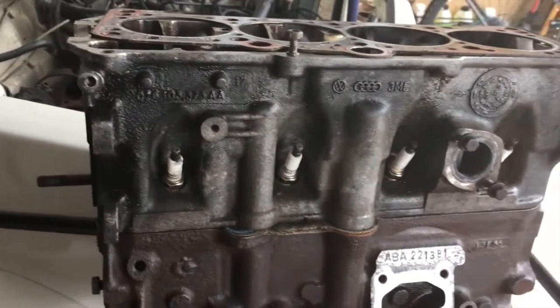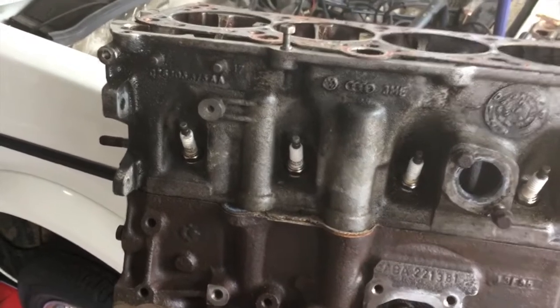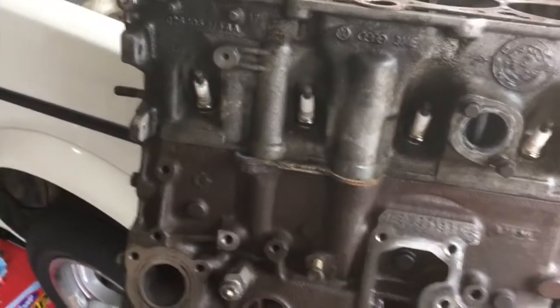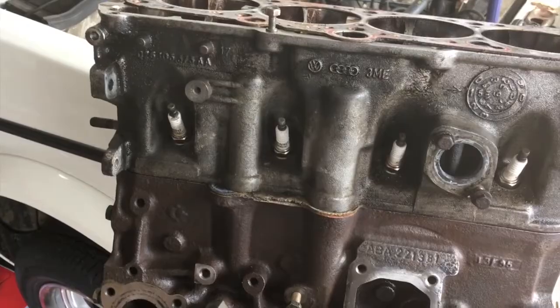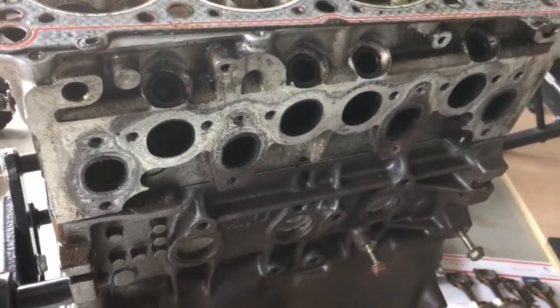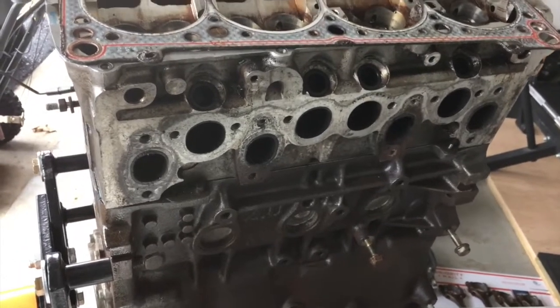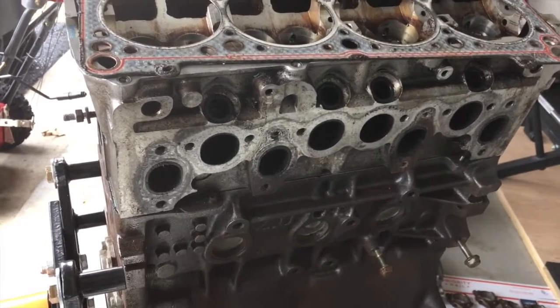It's not even touched. Now, it could have gotten past the valve and not gotten chewed up, and that's why it just got beat into the top of the piston, just smashed back and down. But we'll take a look at the sealing on these cylinders. We're going to take this head off, flip it on its side, and pour water into all of the passages and watch to see where it leaks on the valves. So when we do our valve job, we get an idea for the health of the head. If the head's not healthy, we're not going to reuse it, right?